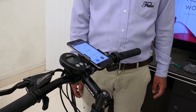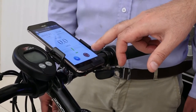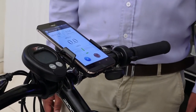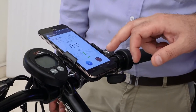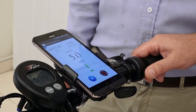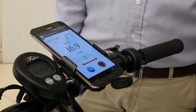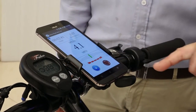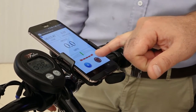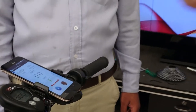There's something interesting we have added in this app — it's called an emergency stop. When I hit this emergency stop, it goes to minus three level of regeneration. I'm going to turn on the motor slightly and then hit it. You can see this also went to minus three, and the console shows one, two, three, four, five bars which indicates minus three. That is one way to apply a brake immediately with a smartphone.